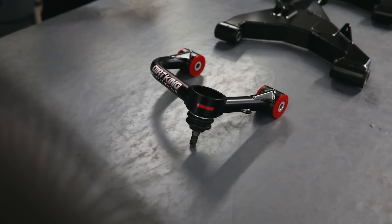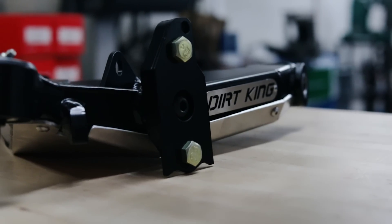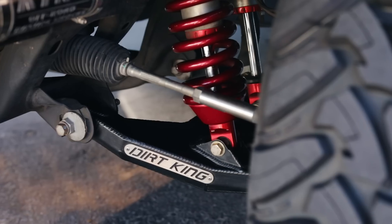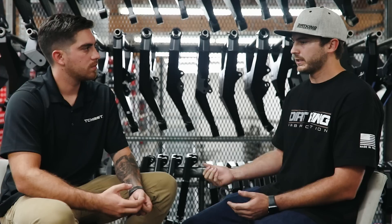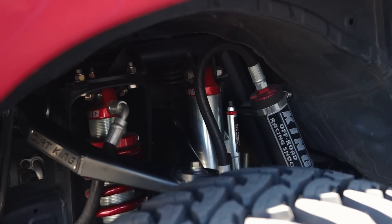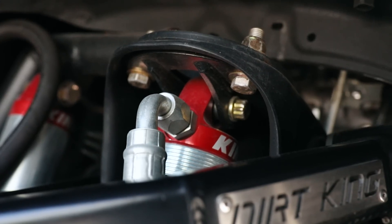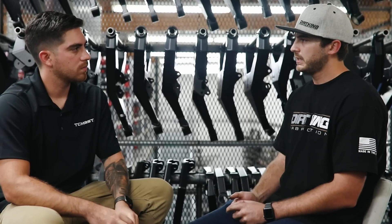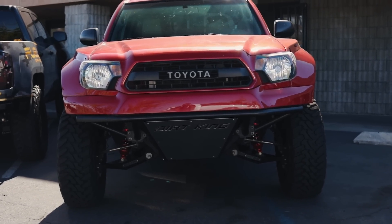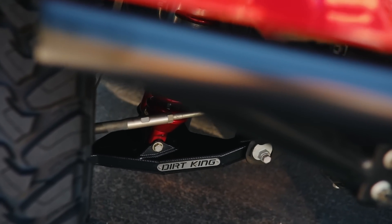Tell me a little bit about the benefits of upgrading to aftermarket control arms. It's kind of one of the best things to start out when you first buy a vehicle. You want to change the wheels and tires, so in order to do that you need to lift the vehicle. You want to get a replacement front coilover or strut and then combine that with the upper control arm. What the upper control arm does is it allows for additional down travel that the shock provides, and it also corrects the geometry by adding caster. The Tacoma has a lot of anti-dive in them, and what that means is that as you increase the lift you decrease caster. So it's super important on Tacomas to add the caster in there as you lift the vehicle.